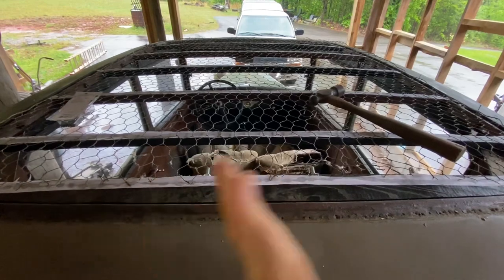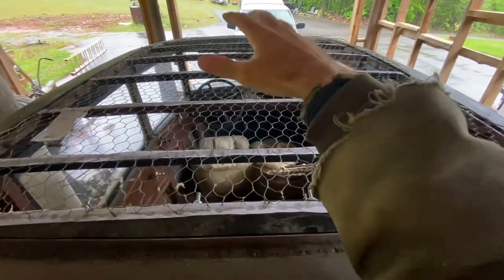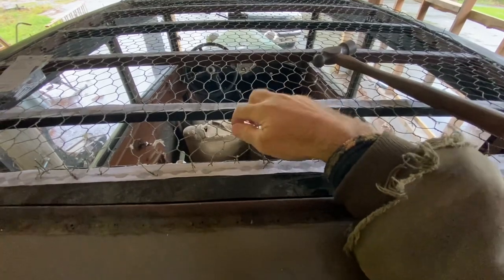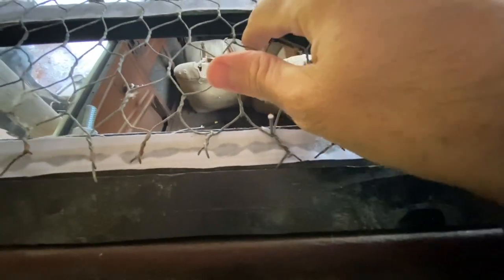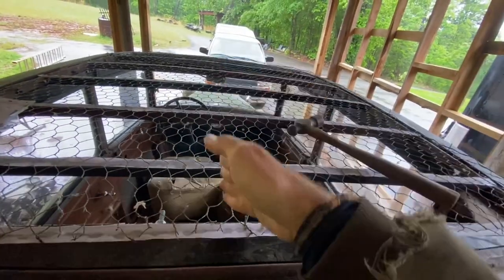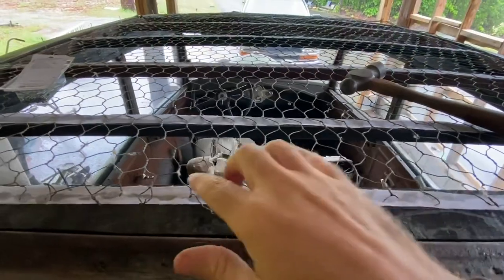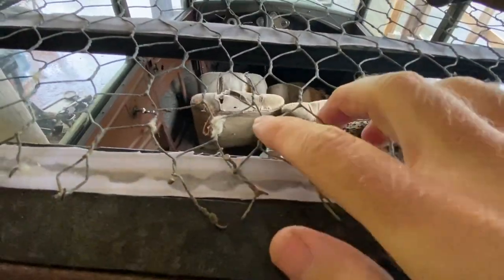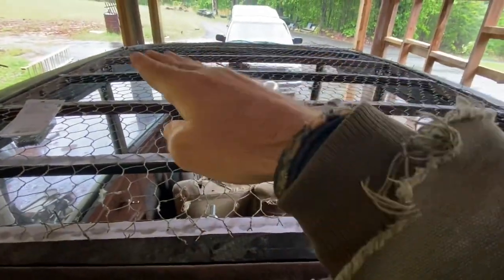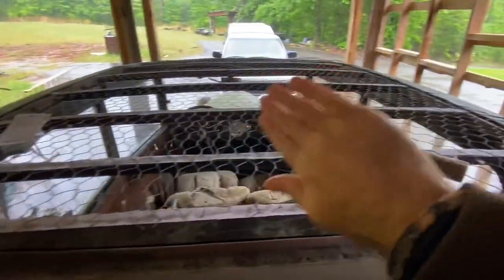Now I'm at the rear center of the car. I've got two nails holding the front only — nothing else is attached. So now I'm going to pull all this wire forward, just like so. I've already got one little nail just started right here and I'm going to get this one hooked over that nail. Now I've got good tension going from here down the middle, and I'm going to work my way over. It all starts from the center and works its way out. I've got a second nail right here and a third nail right here, already pulled over the chicken wire. I'm going to go back to the front and reestablish the whole front line, then come back and stretch it this way. That's the hard part. The easy part is stretching from side to side.